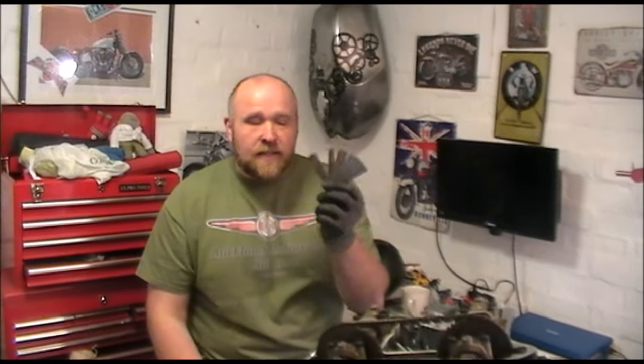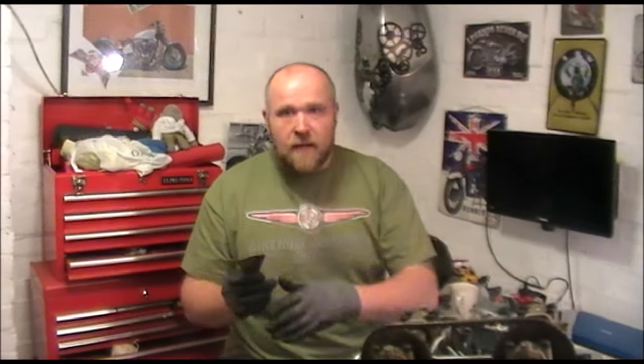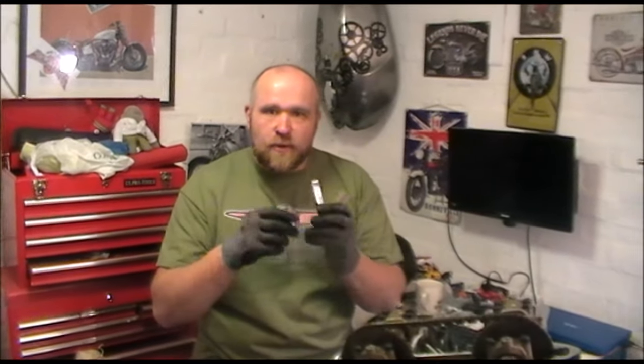The first tool you're going to need is a feeler gauge. These are cheap as chips — about £3 on eBay. They normally come in a larger set of about 50 or 60. Because the range of tolerances between each of the shims is so small, I've got gauges from 4 to 25 — that's the maximum and minimum they can be — so you don't have to shuffle through 60-odd feelers trying to get the right one.